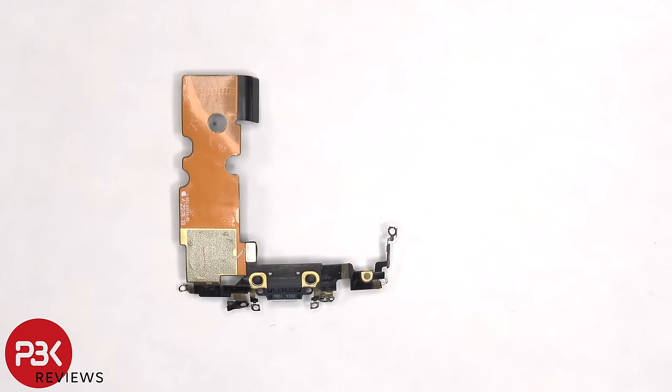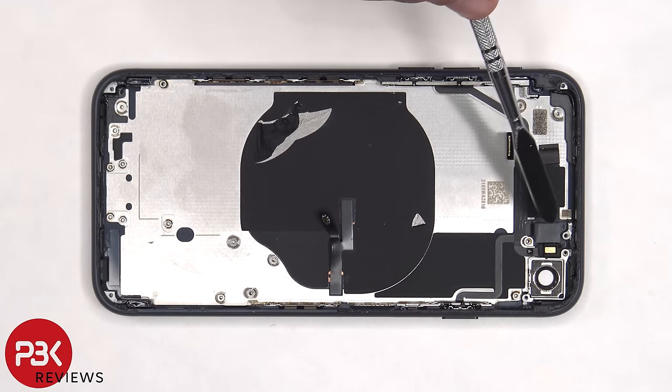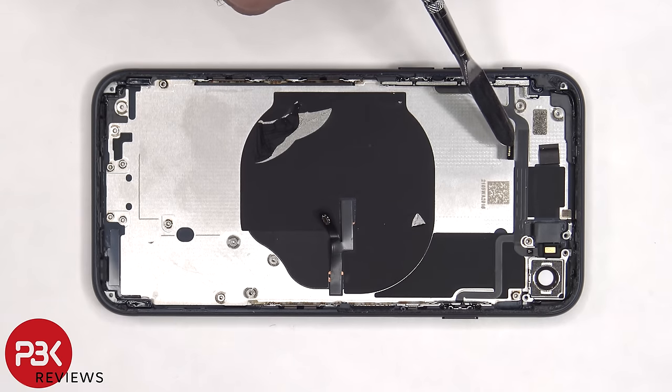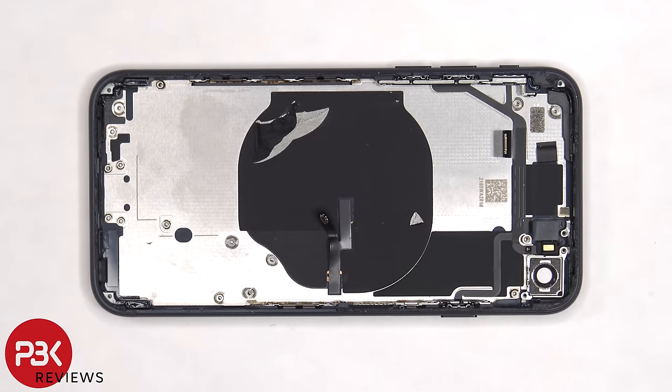Here's a look at the other side of it. The toggle key for putting the phone in silent mode, the volume keys, the flash, the secondary microphone, and the power key are all attached to one flex cable which connects to the main board. So if you needed to replace either of those, you'd have to remove the Phillips screws holding the metal brackets on the inside of the frame, which cover the flex cables and hold the keys in place, and then peel off and replace that flex cable.